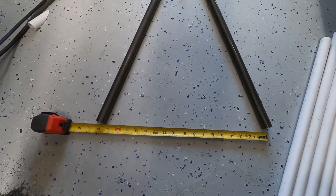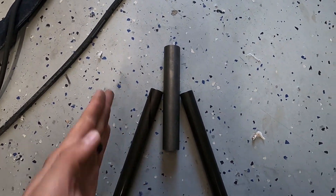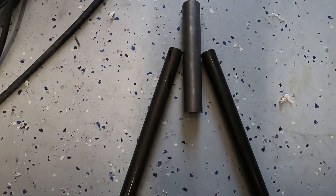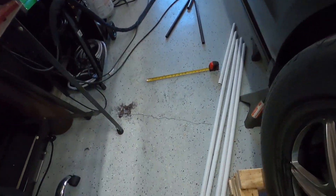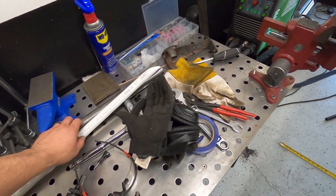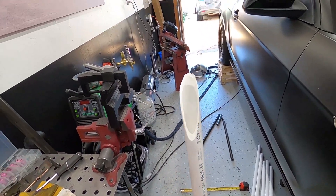We've got 18 inches on center for the tubes. You can see the little mark — just parallel right here — and then I'm going to use a cutoff wheel to cut that off and then use a flapper wheel to notch it out. That's the plan at least. I say that confidently, but there's PVC all over the car because I was practicing. Look how much faith I had in myself — this is how much practice PVC I bought, and this is how much I used before I decided to play the high-stakes game.